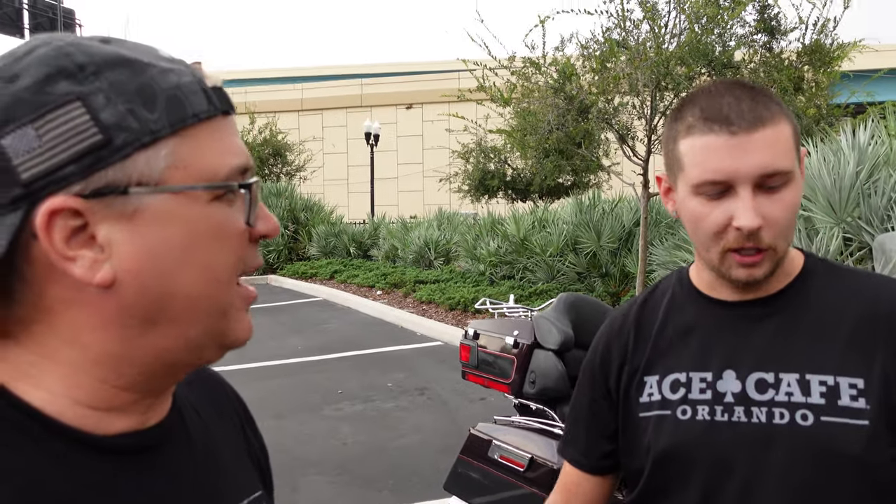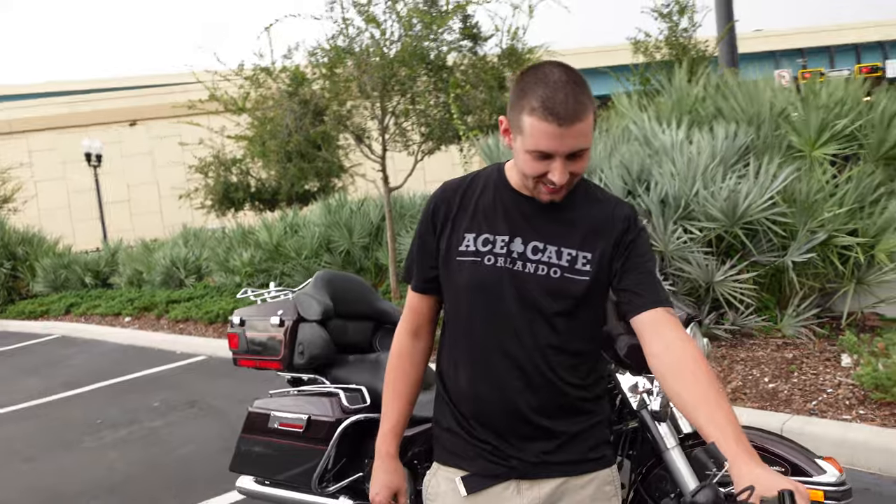We are up at Ace Cafe. I'm with Dakota from Rhino Motorsports, who's here every Thursday. We're going to get this Indian Scout on the dyno. A few weeks ago we got a baseline — I think 64 foot-pounds of torque and right at about 80 horsepower. We're going to look back at that run after we run it now with the tuner on it and see what improvements we got.